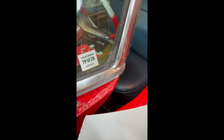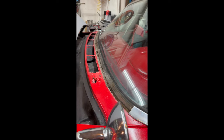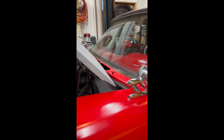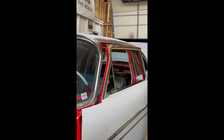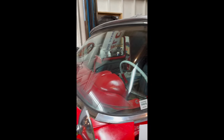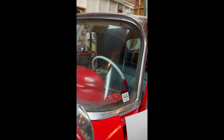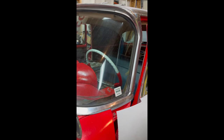So, do we have a gasket for him? I'm going to have to go through. I think I gave up my last good gasket, but I should have a sedan gasket. Oh, it's different. Okay. Yeah, sedans are less desirable. Yeah, they do work in coupes, though. It's just slightly tighter. You have to take an inch out of the top section of it to reduce the overall circumference of the gasket. So it's a last resort. You could use the sedan gasket in a coupe. And because there are variations in the coupes from the factory, one time I was actually able to use a sedan gasket without modification.